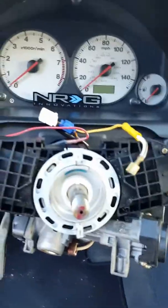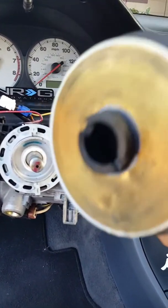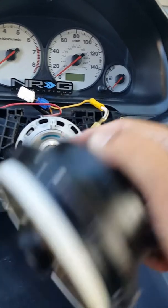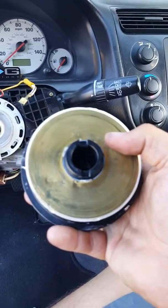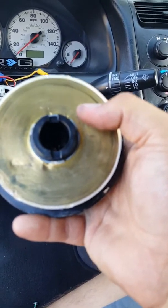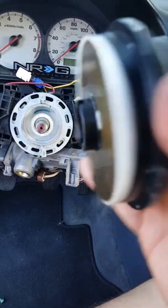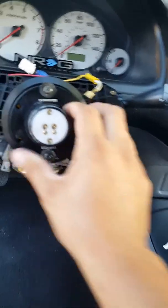When the back of the short hub is attached to the piece of metal in there, that's gonna create the ground. And of course this part has the cables inside that are gonna go into your horn button, so when you put it in here it completes the circuit.